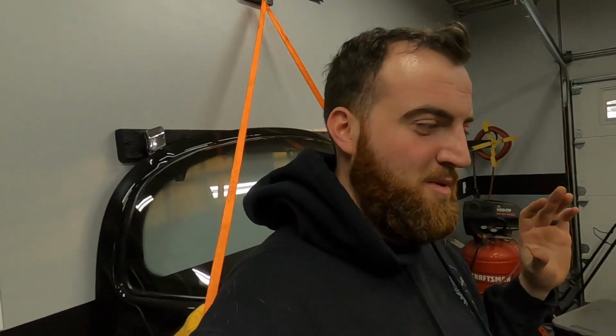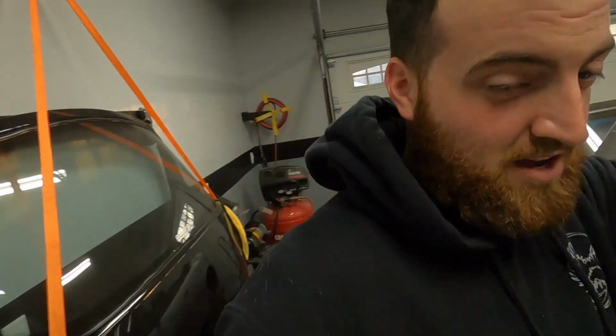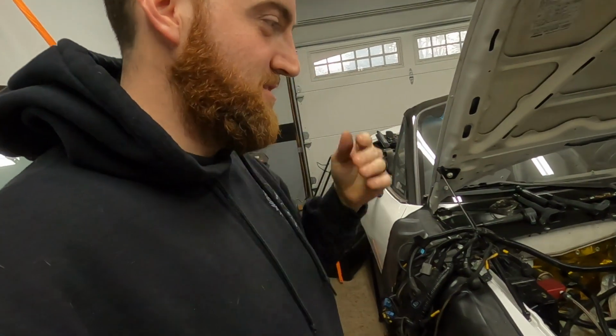Don't ask me how. My methods were not great, but I got it on the first cut. I tried to copy the other pipe as well as I could. I left some margins here and there. It's a tight fit, which is kind of what I want, because as you weld it, it's going to shrink up a little bit. I'm going to do some looking real quick on how much it's going to shrink, because if it's like a 1/16 of an inch, then I will be on the money. So I'll show you guys what I got.